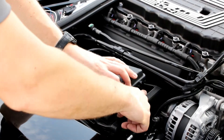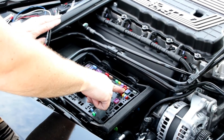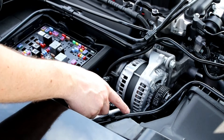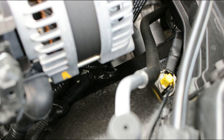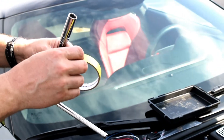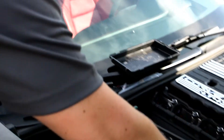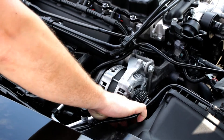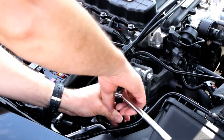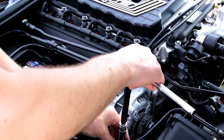Let's go — pull these two tabs back, open this up, put your lid aside. I'm going to be working here with this 20-amp fuse, number 42, on our 2018. First step we're going to do is remove the nut here on this ground, up here between the oil chamber and the air intake. You need a 13mm deep well socket. Little trick here — because you don't want to lose this, put a little piece of tape over it and drop your socket down over top. The extra resistance from the tape will allow you to remove the nut and keep everything attached so you don't drop it down inside your engine bay.